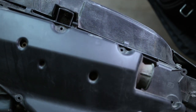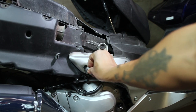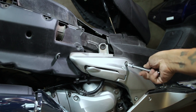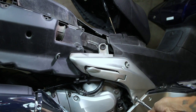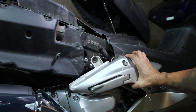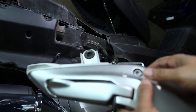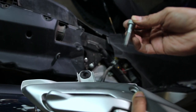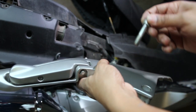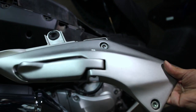Next, we're going to have to remove this rear foot peg right here. You have two 8-millimeter Allen key sockets — hex sockets. I've already loosened them up. Be careful and make sure you keep each one with its respective hole, because these screws are not the same: this one is threaded about two-thirds of the way and the lower one is threaded about half the way. So make sure you keep them in their right places, and place this aside.